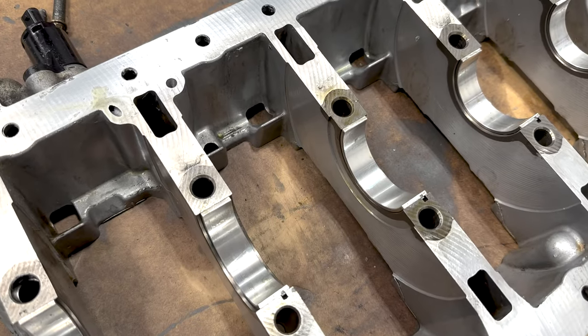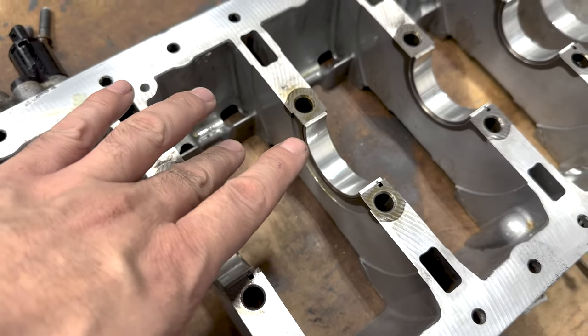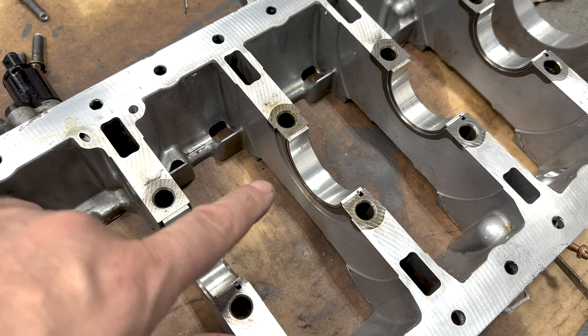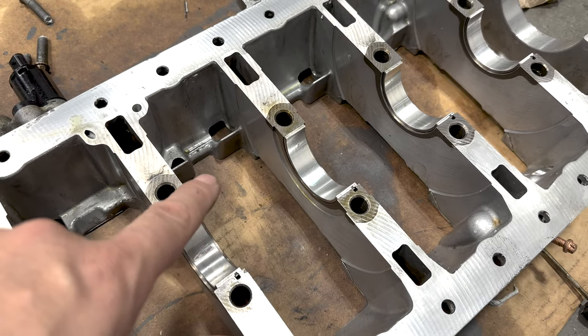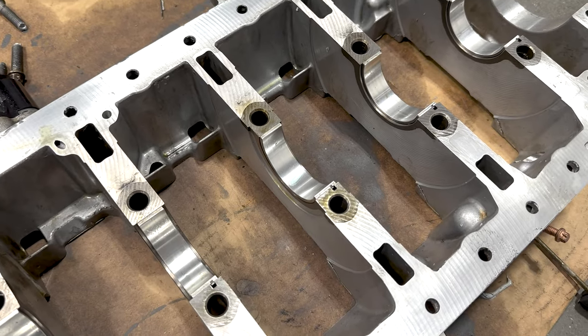So now that we knew the color coding, yellow, blue, and red, we tried a blue and it was on the money, so we ordered a blue lower guide bearing, and I'll show you installing that as an update to the N20 to fix this, and then this thing's gonna be completely dialed in terms of clearances.